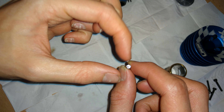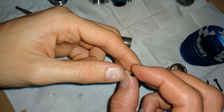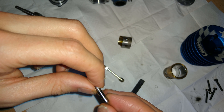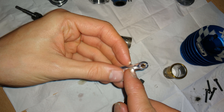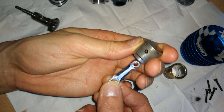There you go — out comes the old rod. Looking at the crank pin, I should really get a micrometer for the exact details. I know Racks from RW Mods uses quite a lot of tools to check for roundness, whether the crank pin is still round. Anyway, we're gonna install the new connecting rod — make sure you install it the correct way. This is your intake, this is your exhaust.